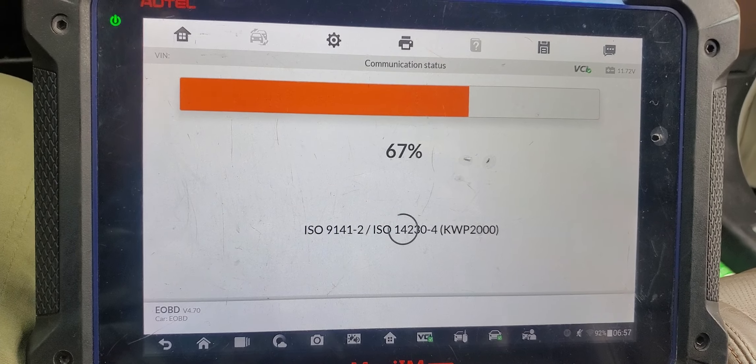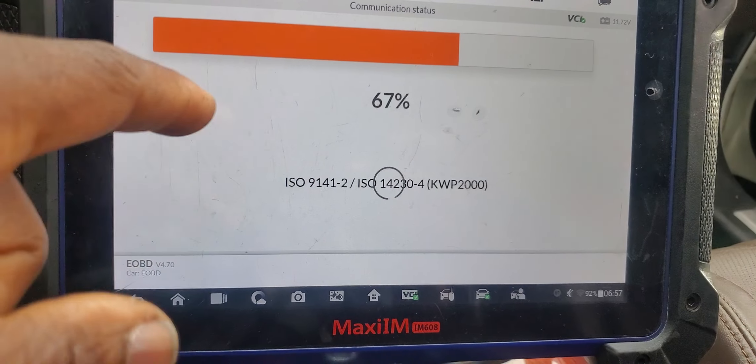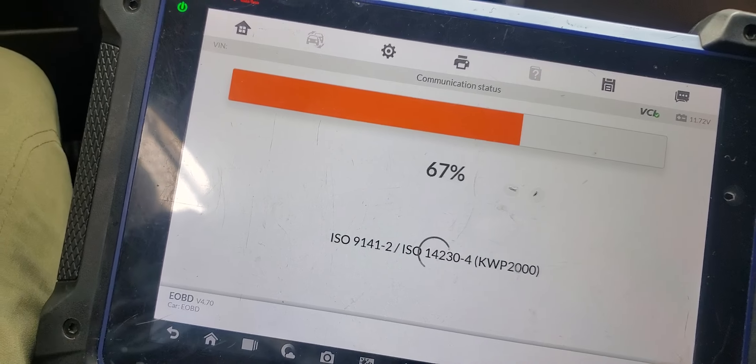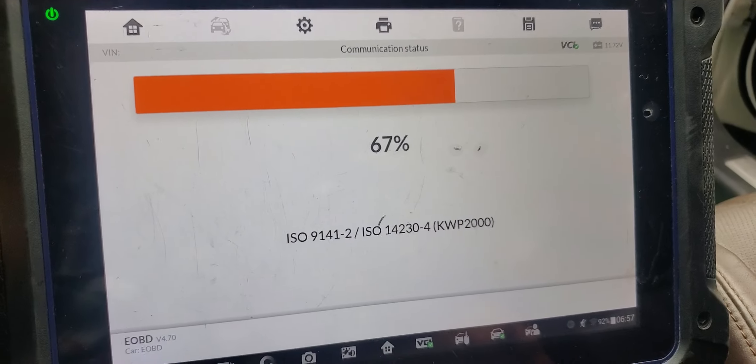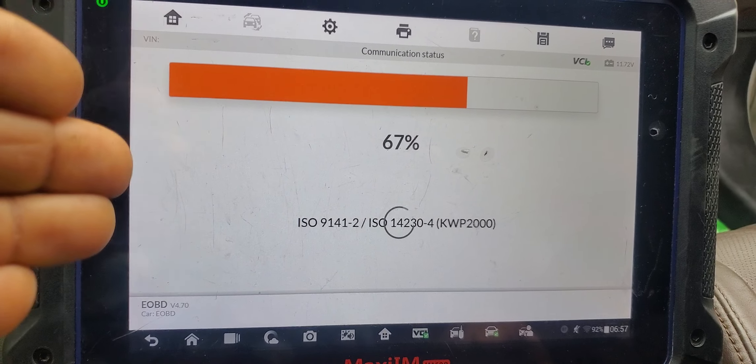This car, from the beginning, we don't have water issues — they were working on it. They left it out and it looks like the rain came in. But the computer is not communicating. BCM is not communicating. That's intermittent — we need to check power and ground. Everything needs to be okay on it. Why is it not talking? With OBD2, it's not talking.